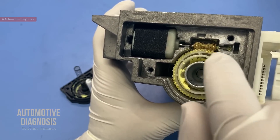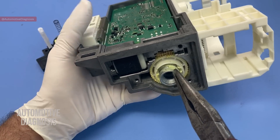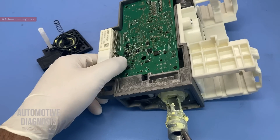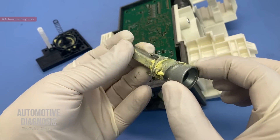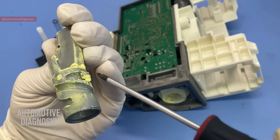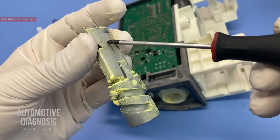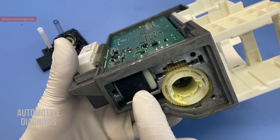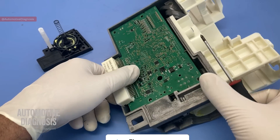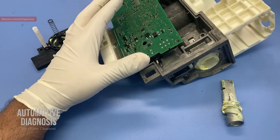We need to understand all different sections of this gear — it's very important. For removing the lock, I just remove this center part like this — it comes out just like this. These two parts are connected to each other. On this part I have a spiral passage with two steel balls, one here and one there. This steering knob is connected to this part, so if this part moves it's going to move the lock knob itself. I'm removing the DC motor as well so I can explain how it all works, then I'll show the control unit.